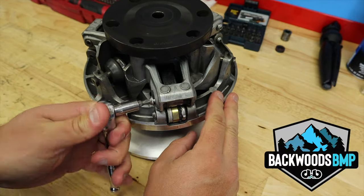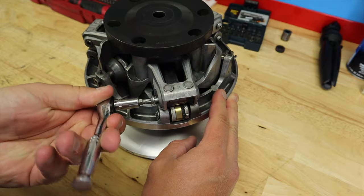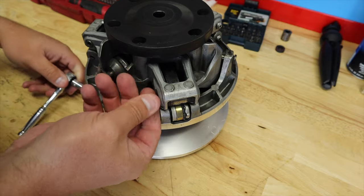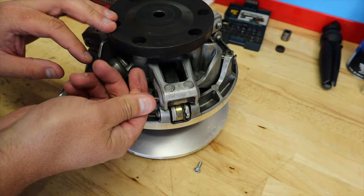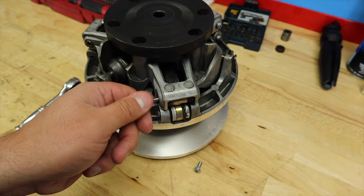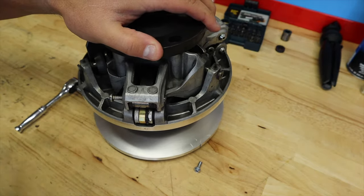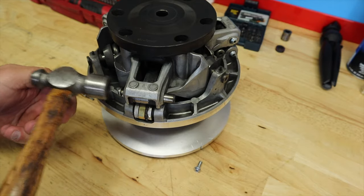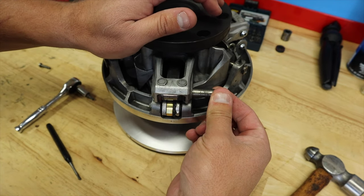Once this T25 is out, you could use this bolt that is in here, the T25 that holds it together, but I would buy a separate bolt — and I don't remember what the thread pitch is — but anyway, I'll show you why here. Because once this is out, we're going to take a sacrificial bolt, put it in here and thread it — you know, five, six, seven threads in or so — get it buried quite a bit. And then we're actually going to tap this with a hammer and get this thing out of there. A couple of taps and there we go. That one was stuck in there pretty good.